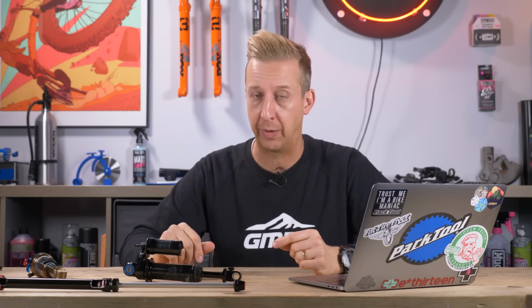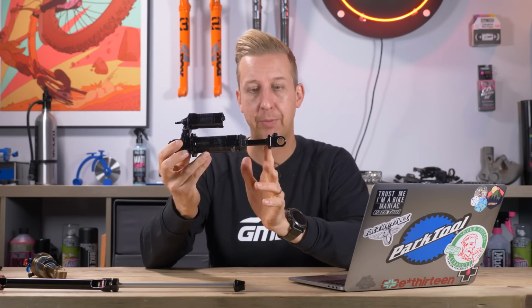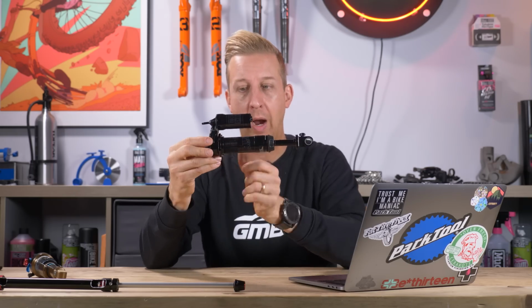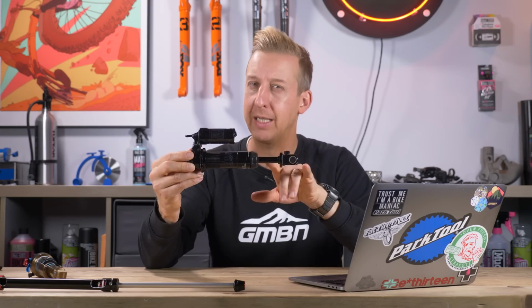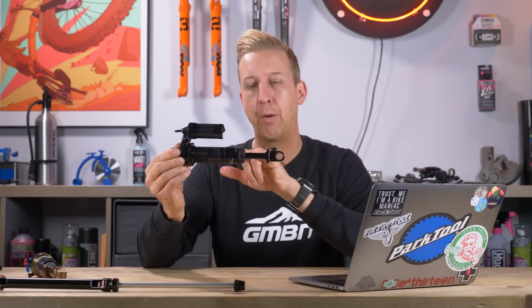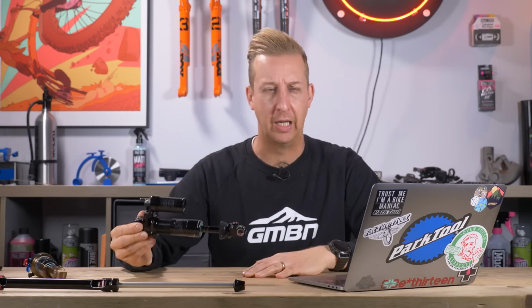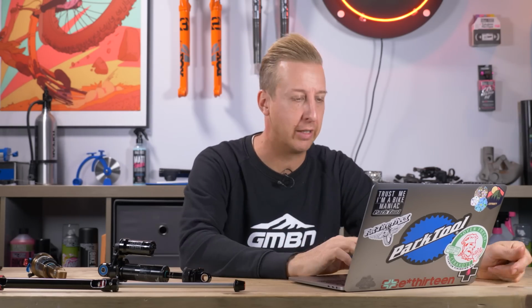And the third thing you need to take into account is the physical length of the coil spring. Now, some coil springs will suit massive downhill shocks, others will suit shorter shocks. You need to know the distance between the spring retaining clip that sits here on the shock and the preload clip when it's fully unwound. So that distance will be the maximum size spring that you can get in there. But typically these will correlate to that secondary number, which will be like the 2.25, and that will be figured out around the stroke of the actual shock as well, which is that movement there. Hopefully that answers that question. There is a bit more information online about it, but that pretty much clears that one up.